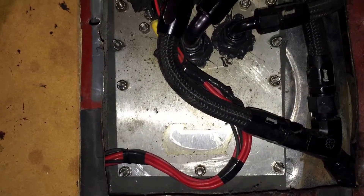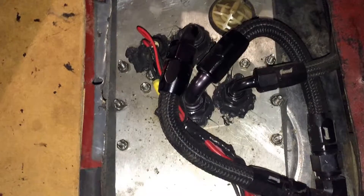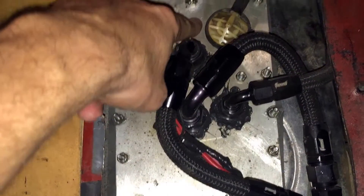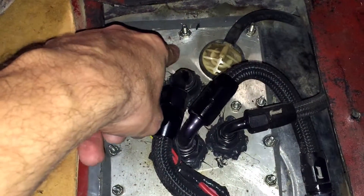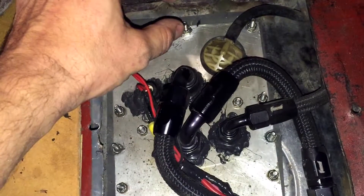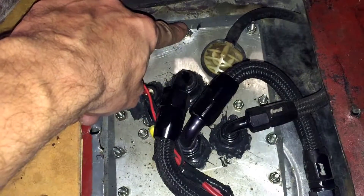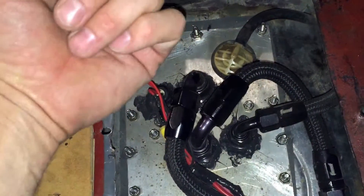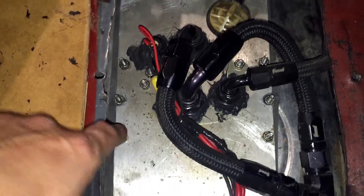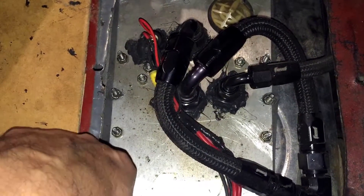You can see that it's just a square plate of aluminum, and I cut a hole that is slightly smaller than the perimeter of this plate. On the inside there is a small steel retainer — that's what these screws come up from. They're threaded into it and they come up from the bottom, then go all the way around the outside of the fuel hat to hold it onto the tank. And this is some gasket material I got from the parts store.